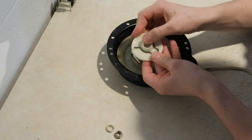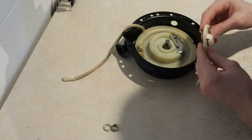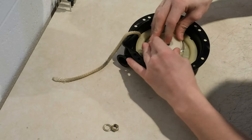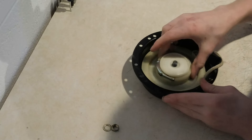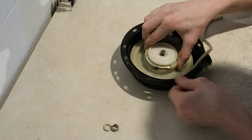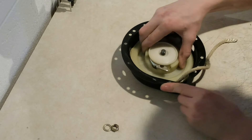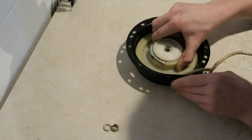There is a flat spot on this friction plate and a flat spot on the center shaft here, so just line that up. What I like to do is position that spring and then turn it to where the flat spot goes down. So now when we rotate it, you can see the pawl sticks out there, but as soon as you let go it goes back in. If it's not sticking out that far, there's something wrong — it should stick out a good half inch and go back in and be flush. If it's not doing that, then there's something wrong; you'll want to fix it or something's going to break.